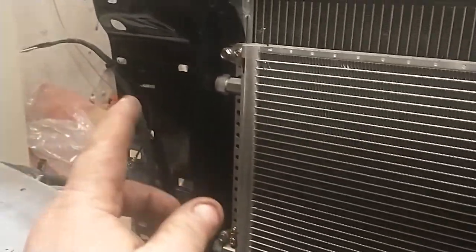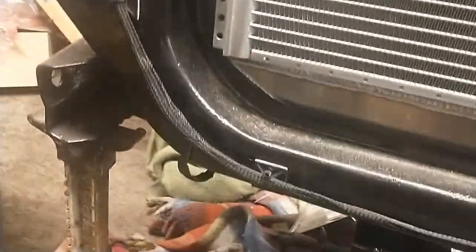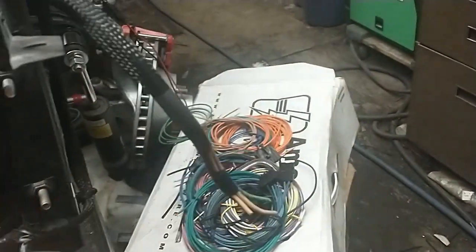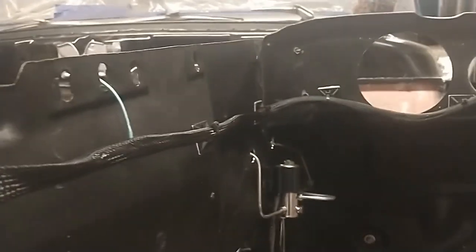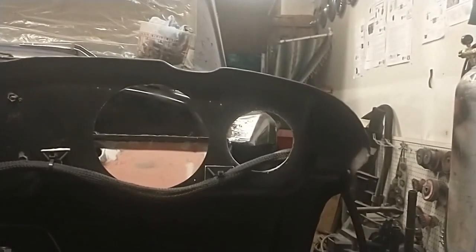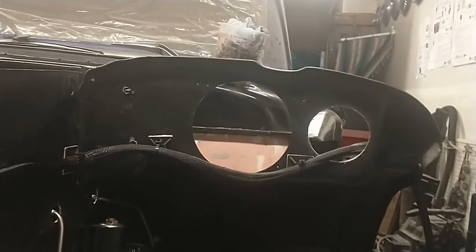The other big progress is I got out the old AutoWire wiring harness kit and started on that. This is all the light harness. There's no inner fender on that side right now so it's just zip-tied up there, but I got it all wrapped up — my parking lights, turn signals on each side, the headlights. I've got my grounds routed on this side. I like to hide all the wiring. This is the horn wire, it goes to the inside. I'll put a grommet on there and I've got this harness running through the hole.